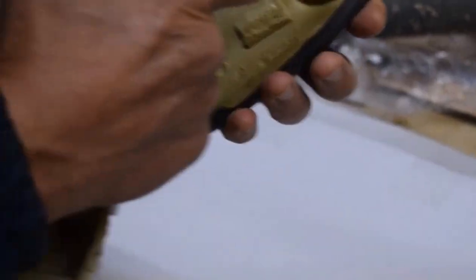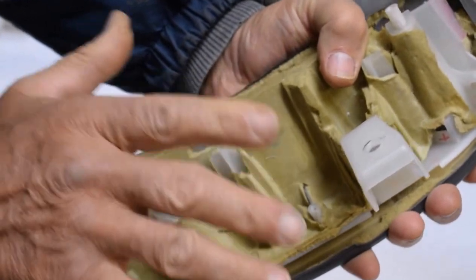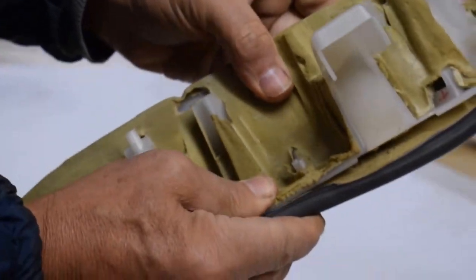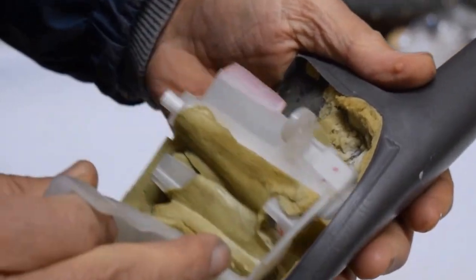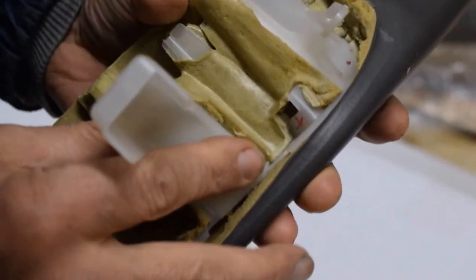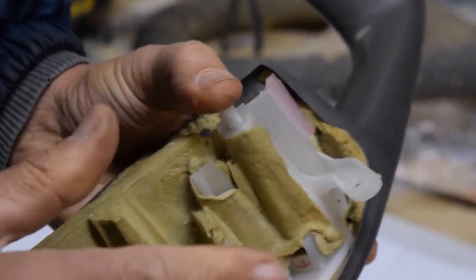The way they put this together, I think this piece of plastic and this piece of plastic were all molded as one piece. Then they stick it in and fill it all up with foam so it's nice and tight. Because it broke, I'm going to drill a couple of holes — I've marked a couple red spots right there — and put in a screw to recreate the original structure of the plastic.